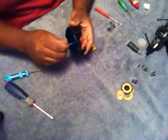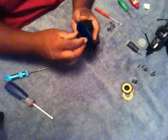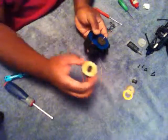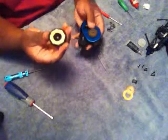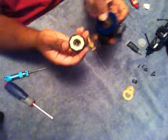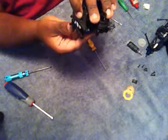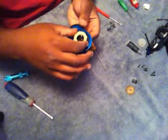And I guess we'll go ahead and we'll put our slipper assembly back on. You're going to have to put 1 plate onto the top shaft. We're going to go ahead and put a disc into the spur gear, a slipper disc. And I usually keep it orientated with the slipper disc upwards so it doesn't fall out, and then bring the car down to it to make sure it stays in place. Then you can flip it over, put our second disc in,